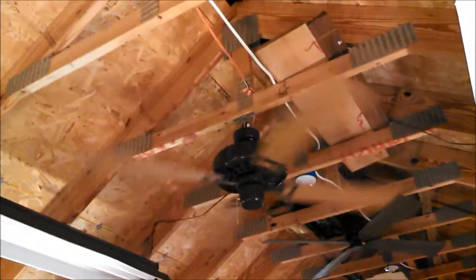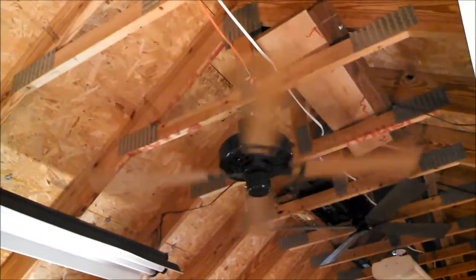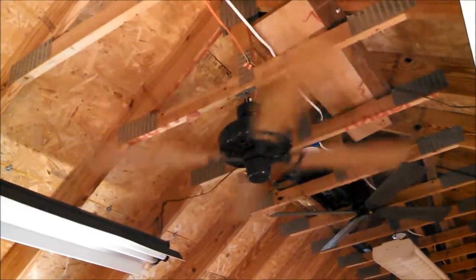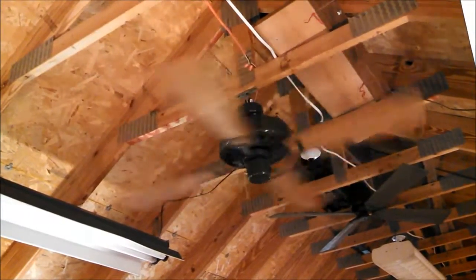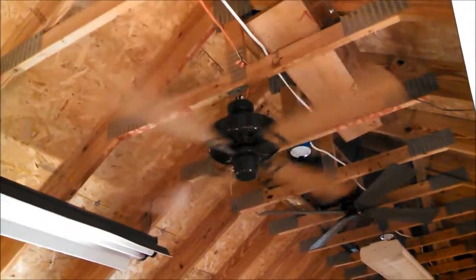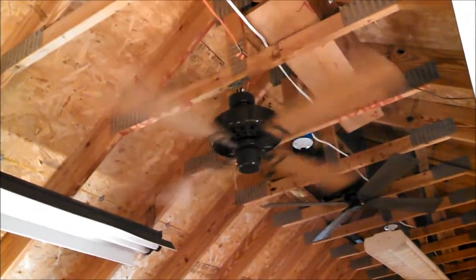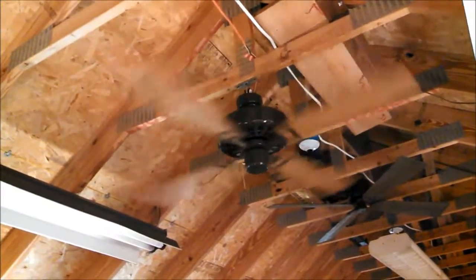This is an 84 model with the black stamped motor. The earliest imported Nutones had black cast motors, then they had gold stamped motors, and then black stamped motors. This is the black stamped motor. And we talk about some Nutones being fast and some being slow. The gold ones are typically fast. The cast ones are typically slow. This one seemed a little slow, so I switched the cap.